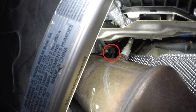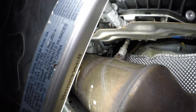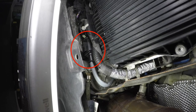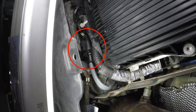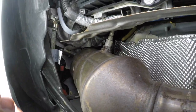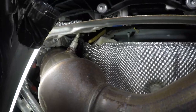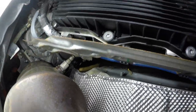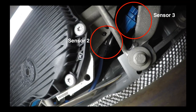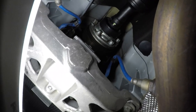In this freeze frame, that gray wire is the upstream O2 sensor — sensor one — and it inserts right underneath the transmission. The next one is a lot easier to follow. It's sensor two, right smack dab in the middle of the catalytic converter. You can follow the blue wire all the way back to the gray clip marked sensor two. Sensor three, the blue one, is right back around the bend of the exhaust.